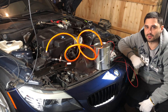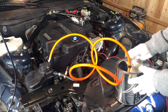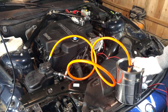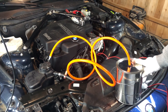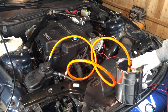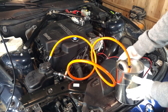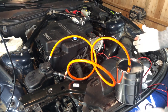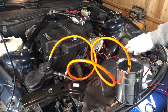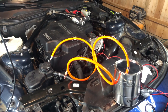Normally an automotive smoke machine would cost you a few hundred dollars, which is why I decided to go for one of these custom-made DIY jobs. You can actually make these at home — there's a really good video on YouTube. I got this on eBay for about $80; they also sell them on Amazon. It's just a paint can that's empty and clean with a little wire and wick inside, into which you pour some mineral oil. It also has a connection for your air hose.